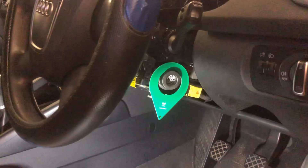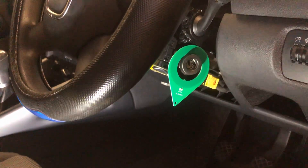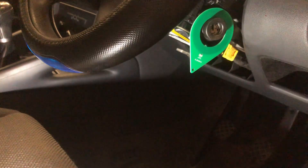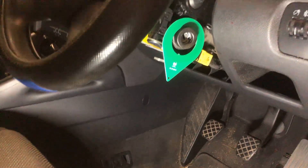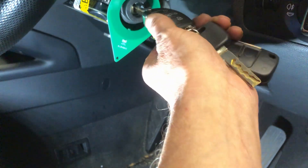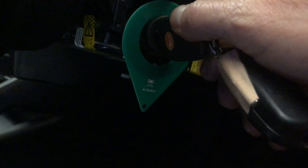We are reassembled. It turns out it had an aftermarket lock barrel in and that was a bit of a struggle — it's a little bit temporary and I'll do that better for the customer. But we know what the fault is — problem with aftermarket parts. Now when we put the key in, watch the red LED on the transceiver coil tester — see that little flick? That's all it needs.